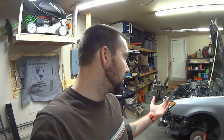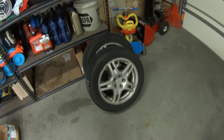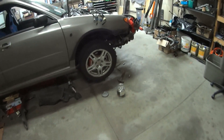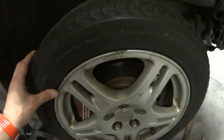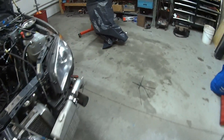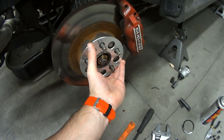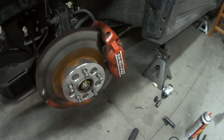It's actually kind of a cool thing to have the engine back out. There are some oil lines that I was able to tidy up. I've been doing a little bit of cleaning up the engine bay, which is nice. Unfortunately, now it's winter time, so we will have snow out on the roads. What I've done is I actually picked up some snow tires for my car. These are just WRX rims from 2002-2003, and I got a set of used snow tires that look reasonable. I did have to run 3mm spacers to clear my 4 pots. This is the 3mm spacer - it just gives enough offset so those WRX wheels will clear the 06-07 WRX 4-pot brakes.